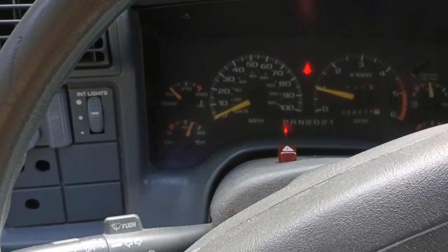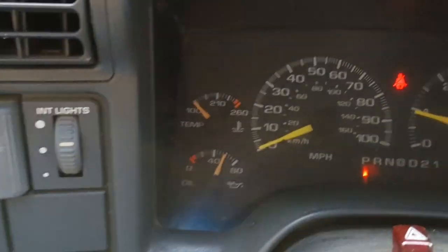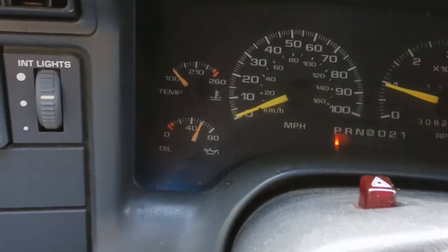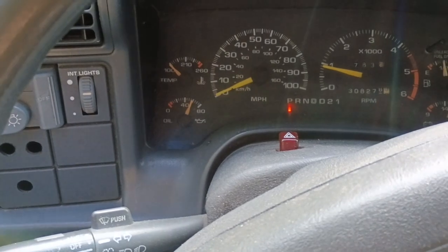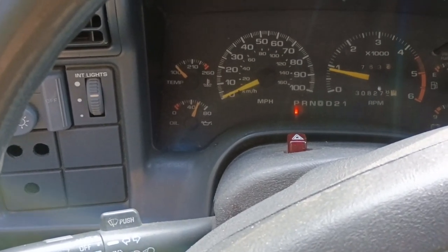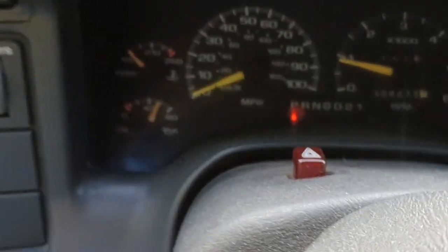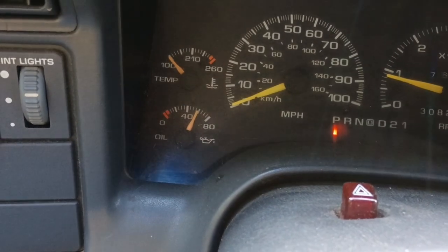As I drive this thing, I'll turn the video back on to show oil pressures. This is full cold. The temperature goes up to about one minor division above the first major division — about 165-ish. The oil pressure is reaching 65 pounds during this warm-up drive, very light throttle, light duty. Notice this engine is at 308,000 miles and showing 60 pounds oil pressure.